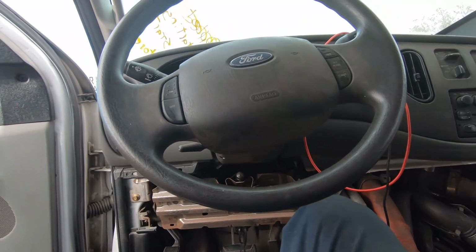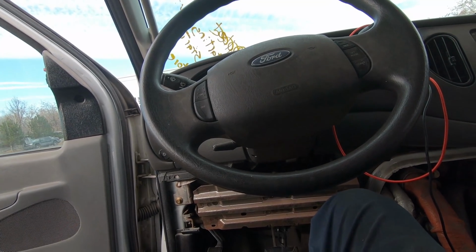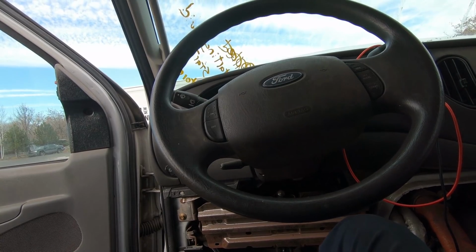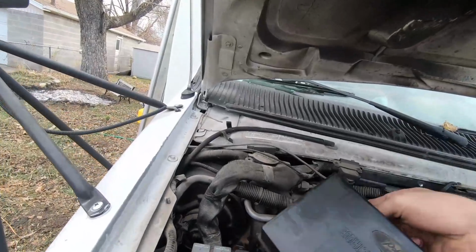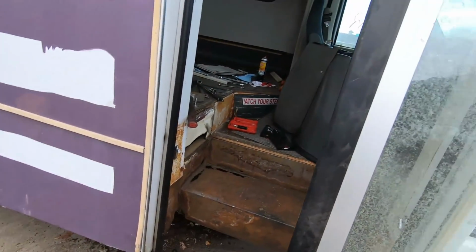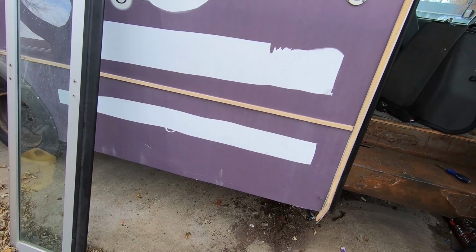Okay, so they're not starting still, so it may be a leak in that high pressure oil system for those injectors. So we'll pull out our scan tool again and read. We were getting 12 PSI on that fuel system. So hopefully we're getting more, and we just have to do something else besides tear apart that high pressure oil system. But my scan tool will tell us here in a moment. All right, well, that did not build enough pressure. I think we got up to like 60 PSI after some pretty intense cranking on that starter, which I'm not going to repeat. I don't know if I got that on video or not, but 60 PSI was the max we got there.